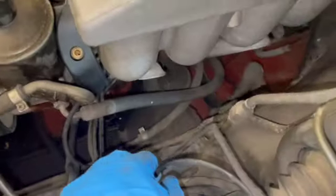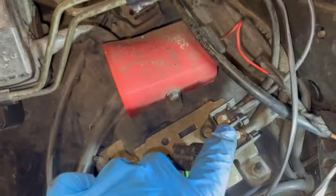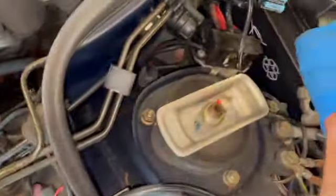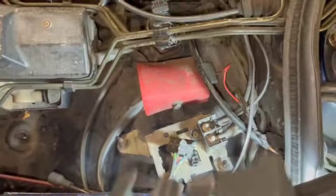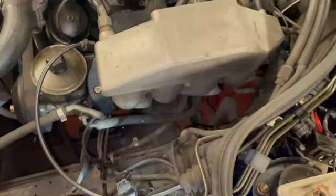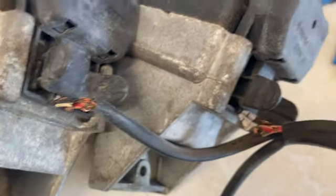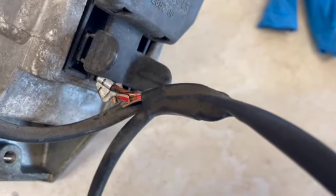So before you're able to get the coils out, because they're now down in there, probably take them out that way. You want to disconnect the earth, which is here, which is under that cover normally. I think it's 7mm. Undo that, and then we should be able to get them out. The coils are out, and as you can tell from that wiring, it's a bit past its best.